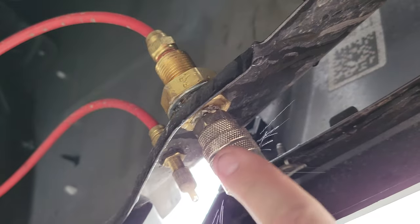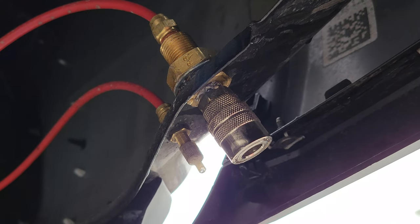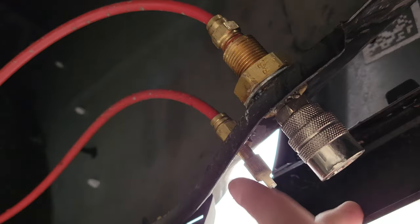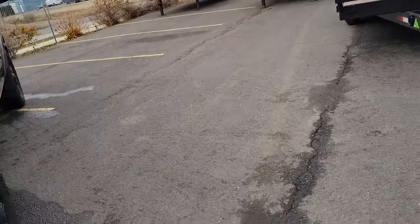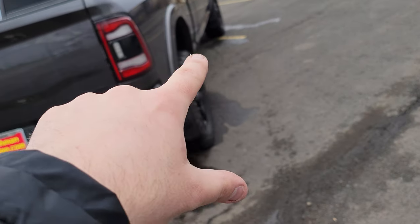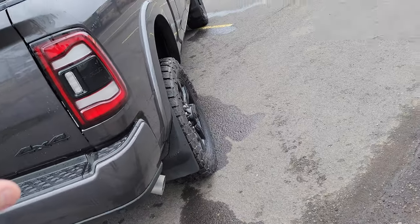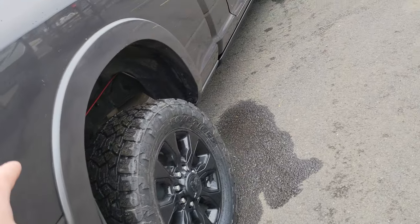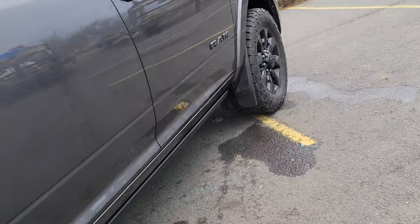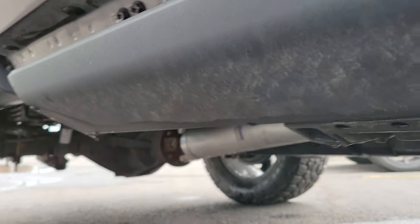I'm about to dust it off with some WD-40 and put a cap on it, plus a nipple fitting. What I did is ran a hose to the airbags alone. There's one air hose connecting the two airbags, then a T running back to the bumper, and another T — that red hose from the switch — coming to that side of the line. This is the quick connect at the rear: if the airbag compressor fails, I have quick access.